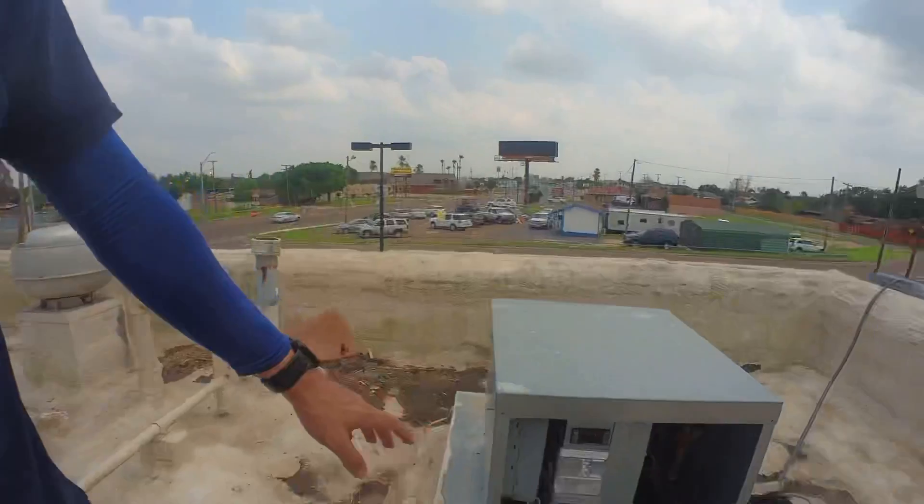I don't see anything too wrong here for me to mess with anything else except the defrost timer, which was not even set up, so we set that up. My only concern is it has not turned back on yet, so I need to go down there. I did move the thermostat up slightly, so if it's not kicking on I'm probably going to have to replace that thermostat. I'm also going to take a look at that expansion valve to see what refrigerant it's supposed to be running on, so I can make a better recommendation.